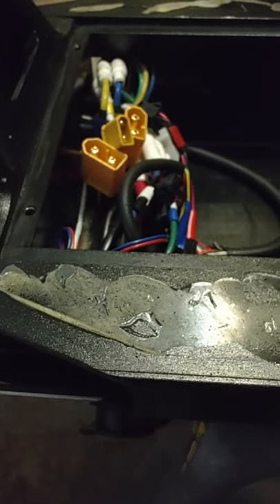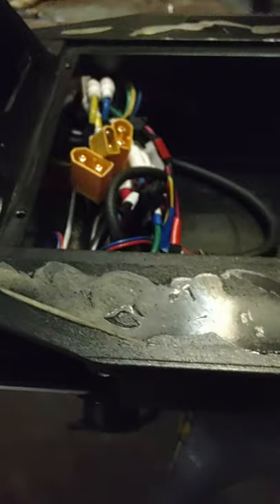That's the best recommendation I have for waterproofing the Mantis 10 — it definitely needs it more up here in the box area. There's a hole right in there that leads right into the battery pack, and this guy's scooter I have now actually has a new controller because of this. There is a slot right here going in with the wires that we need to address. I will backfill this slot so there's not just silicone pumped on top — that looks trashy. Then I'll put my plastic bag in here and pump silicone on top of that.